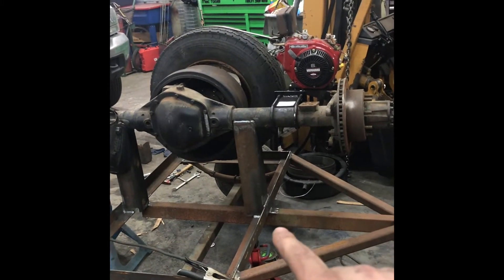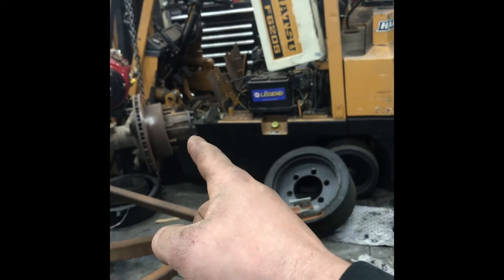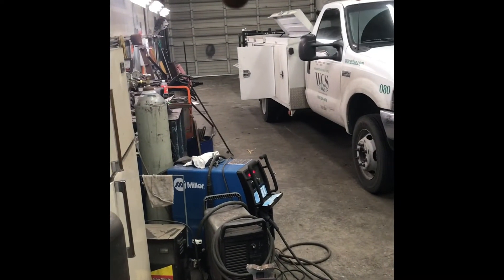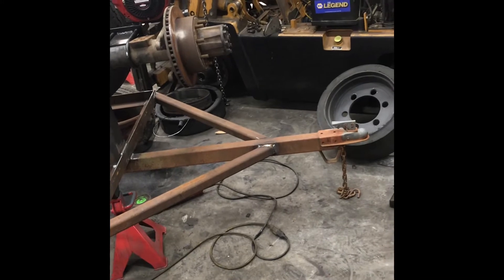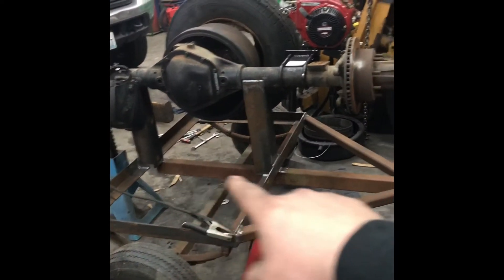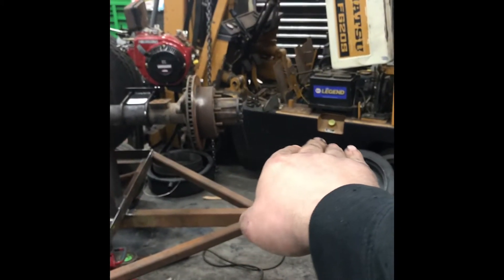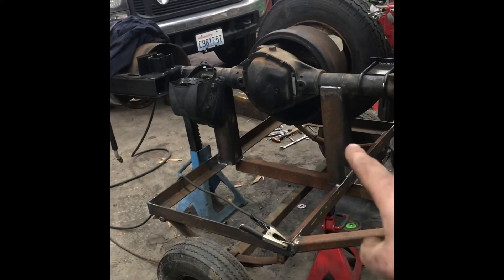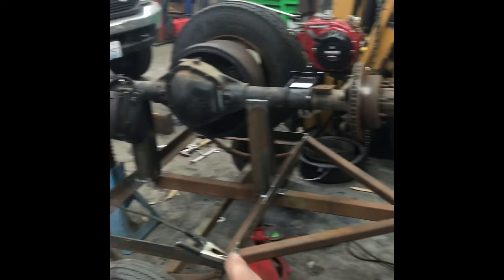I ended up with 18 inches from that axle to the trailer ball. This trailer will more than likely only be towed by the wood burner you can see poking out from behind the service truck over there — that's a low-to-the-ground, two-wheel drive. My bumper ball where the trailer would sit is 13 and a half inches. The trailer is sitting dead level right now and that tongue is sitting at 13. So when I drop the trailer on, it will technically be a little bit nose down, which is perfect because the axle is still supported by a jack stand. When I take those two jack stands out from underneath, it will settle down onto the springs and should sit right about dead level behind the truck.